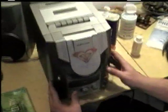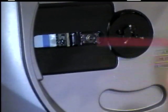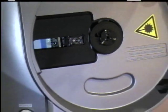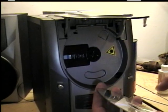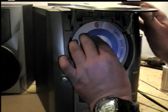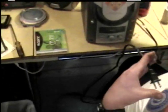For the CD part, you've got your laser head there. You do not want to touch that head with anything, so just blow it out real good. There's a product called a laser lens cleaner — this works for DVDs, CDs, and possibly Blu-rays. It's got little brushes on it that brush over the head and clean it. You do not want to take a cotton swab or your finger to it. Put it in like a normal CD, shut the door, and allow plenty of time to dry before inserting any disc.